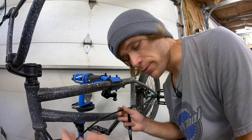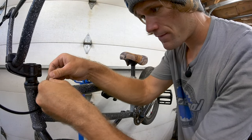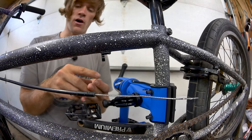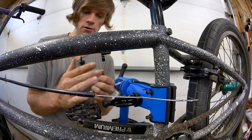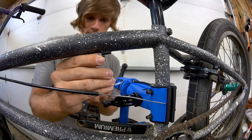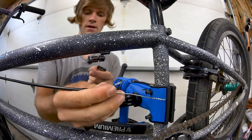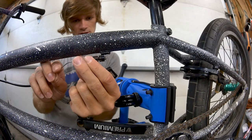Before continuing to the back of the bike, put a velcro strap on to keep your cable under control so you don't have a floppy cable going everywhere. Since we're demonstrating a straight cable setup today — we'll also talk about straddle cable setups — thread your barrel adjuster into the cable guide. Again, leave a little bit of adjustment in there just in case, then thread your cable through.